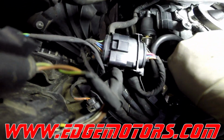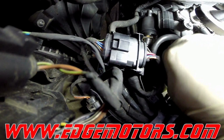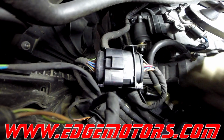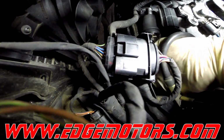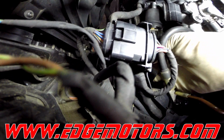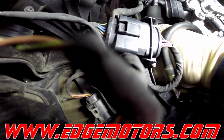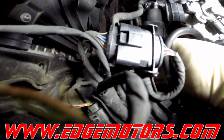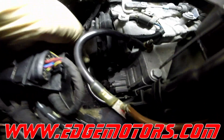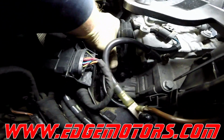Don't over tighten it, don't rip the stud out of the solenoid, but it's gotta be pretty tight, otherwise it's gonna give you problems later on. If it has a bad connection, the wire might melt, causing all sorts of issues. Put the cover back on. Remember, it gets plugged onto the nut on the stud.